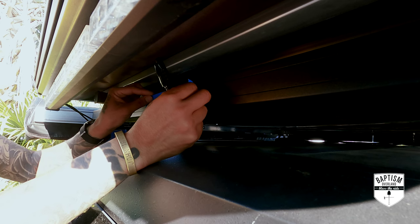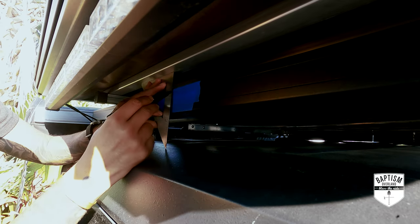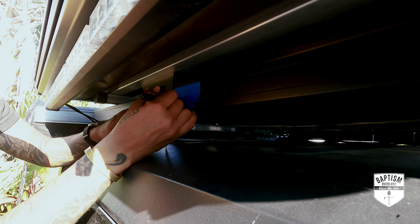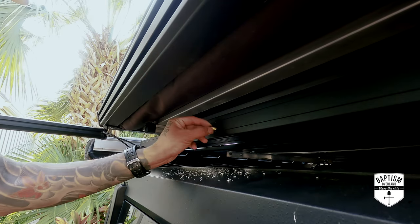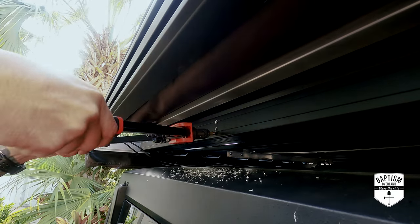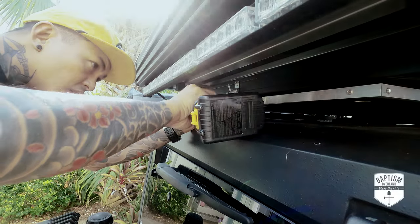This is the part that has been making me really nervous because I have to drill holes into the rack — everything needs to be precise as you only have one chance. First is finding the middle point of the rack. Inside the rack there is a ledge in the middle you can't see — about an inch from the bottom and about seven-eighths of an inch from the top. I made a mark so I know not to drill in that area. I did one hole first by starting with a small pilot hole and then enlarging it for a rivnut, then did another test fit to line up the second hole and repeated the process. I installed the rivnuts with a rivnut tool, then bolted in the clasp with a lock washer. Once the clasp was installed, I set the table in to figure out where on the table side I'll attach the hook — and after attaching the hook, I was done. Or so I thought.